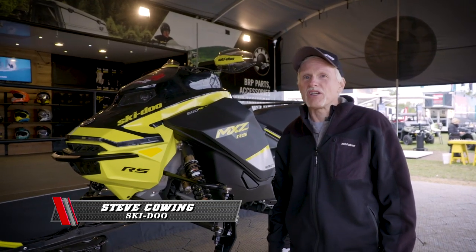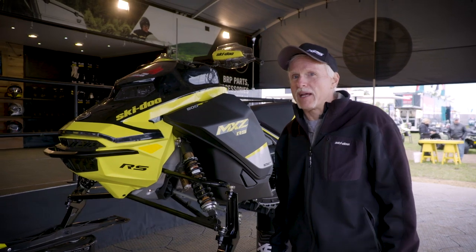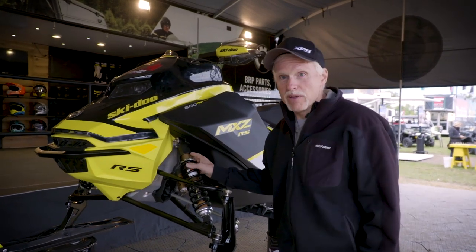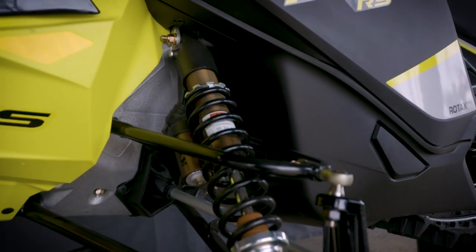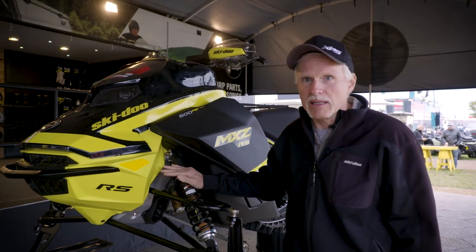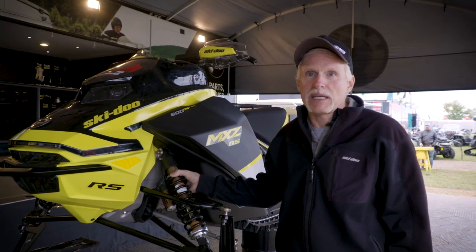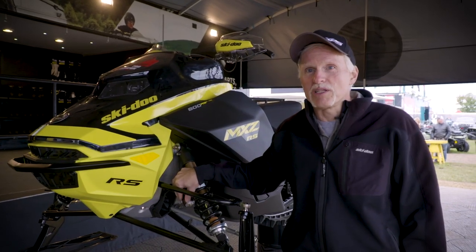Welcome to Hay Days 2019. Yesterday we introduced the new Ski-Doo race sled, so we'll go over some of the changes that were part of that package. You'll notice on the front of the vehicle we've turned the shock reservoirs inward. The reason being is when you get into a first turn, sometimes it gets kind of messy in there — we don't want anybody getting hit in the side, knocking off the reservoir and breaking it. The new base valve has high and low speed compression adjustments plus high and low speed rebound adjustments.